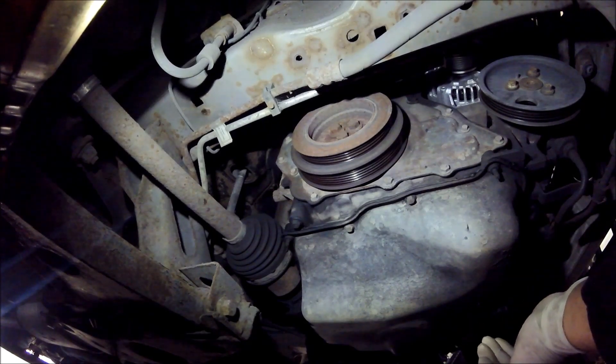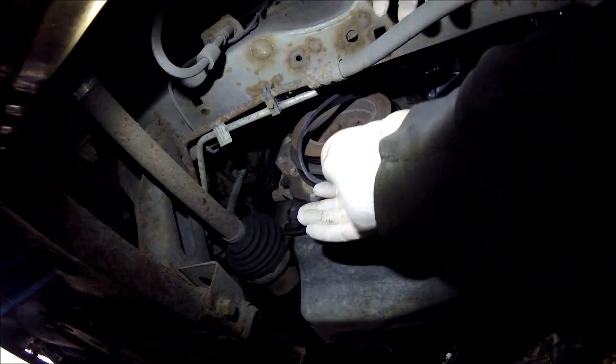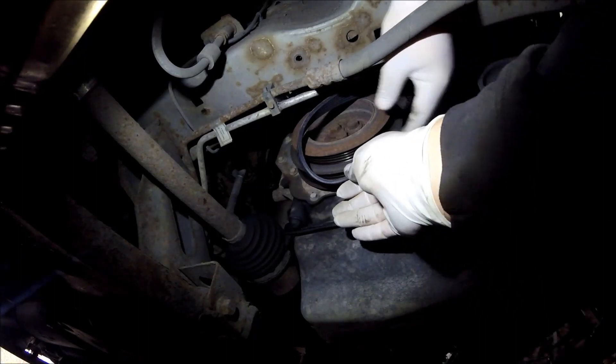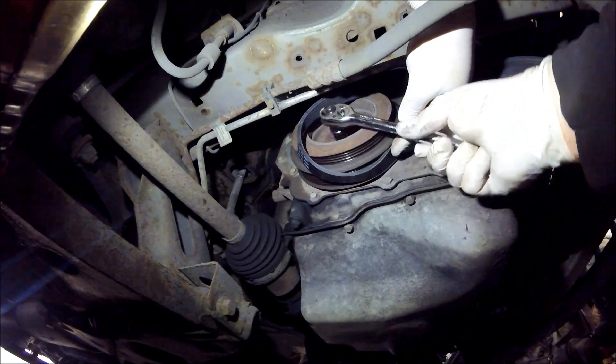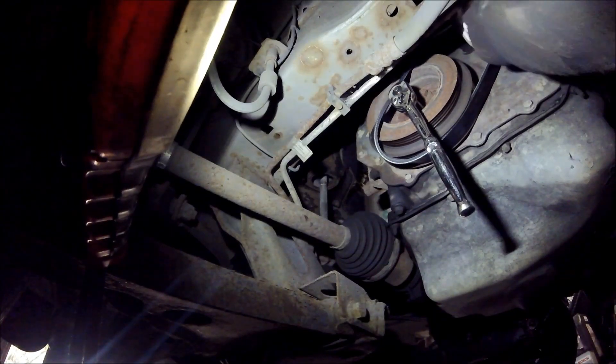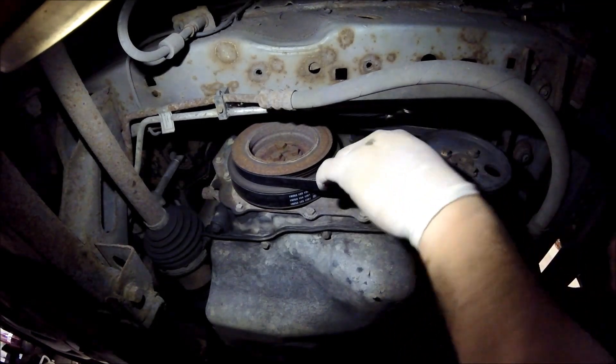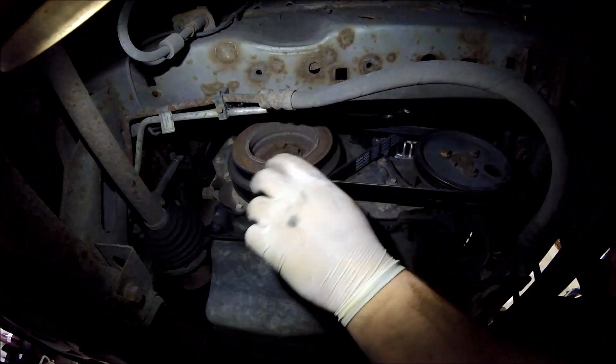It's not good to spin it back the other way because all the tension is off on the chain and you can jump the timing chain. Put the wider belt in place on the main gear. We've levered the belts on now — they're on. All sorted, all good.